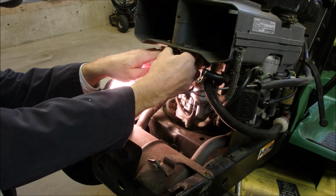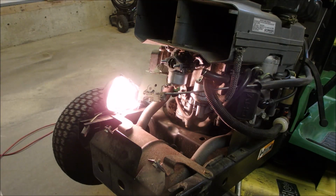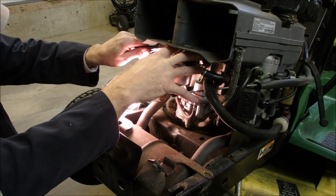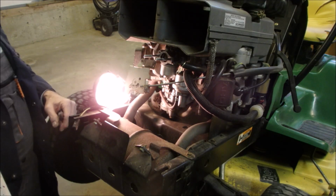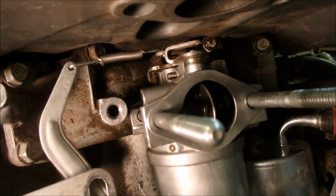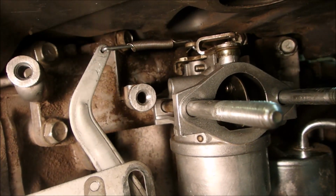I put the intake gasket on already. Here it is. Now I just have to get a pair of pliers and put this dampening spring on the same hole. This is the tricky one. I got it in, but I went in the bottom part of the hole. The choke arm. Oh, let me show you what we got. Right there. You guys see that? That bracket coming up on the right there. It's kind of crooked to the right, and then the throttle arm with the spring connected.